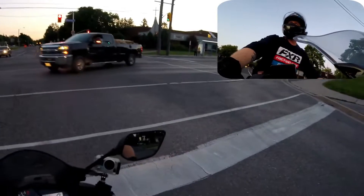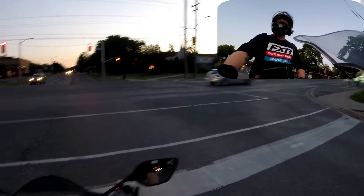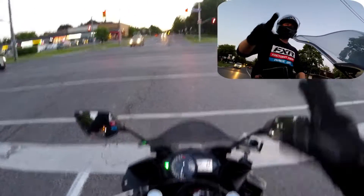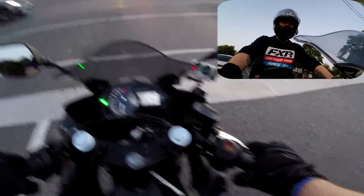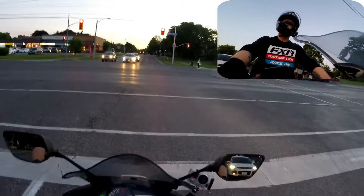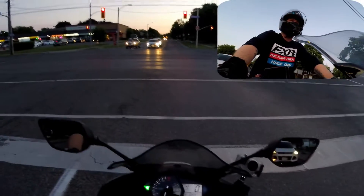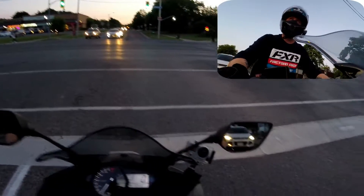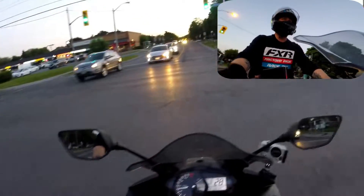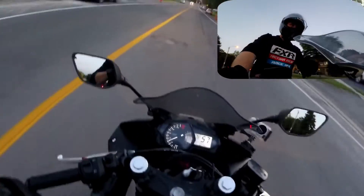I still got the massive NASA docking station flashers. I have yet to exchange those. I do have some at home — the same ones I used on my WR — which are little super-duper flashers that look almost like the stock ones, just much, much smaller. They're almost $15 a pair — you can't go wrong with that. I've got to put those on. The only thing you need is a flasher relay because they are LED. I also need to find a backing bracket — I used to have a bunch but got rid of them all, so now that I need them, I don't have them.